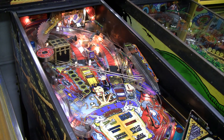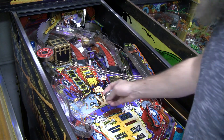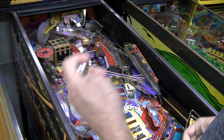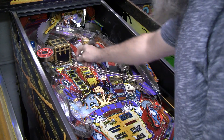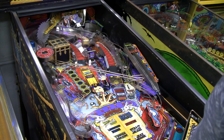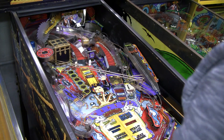The reason for this is there's what's called a proximity sensor. It's a little sensor embedded under the playfield that senses the metal in the ball — a hidden sensor. And it drifts out of adjustment. It has a little adjustment on the board that you have to constantly fiddle with, and it just drifts. It's a pain in the butt.